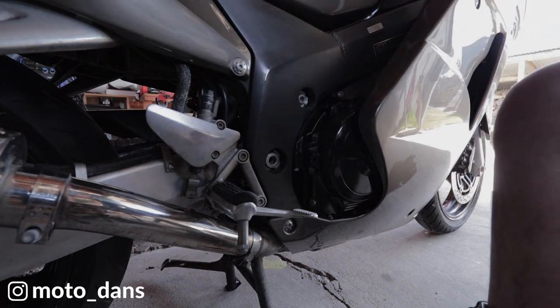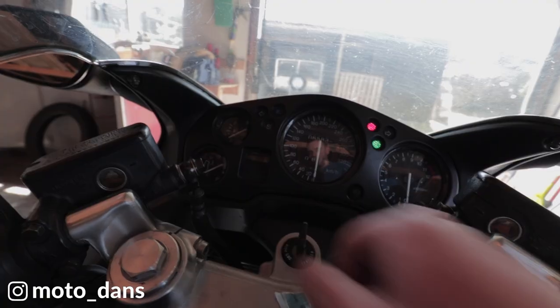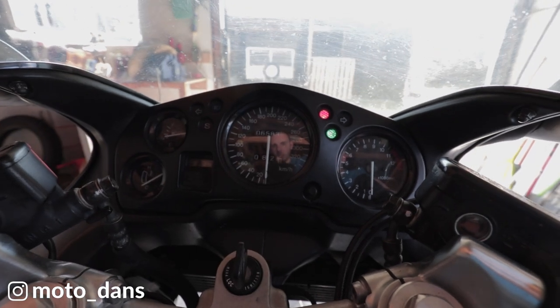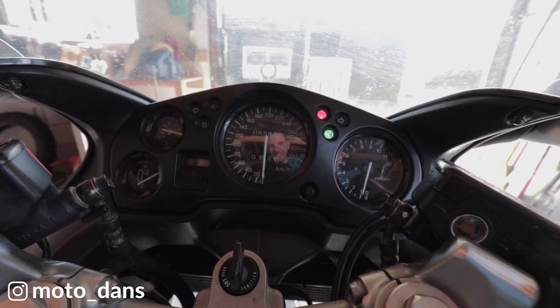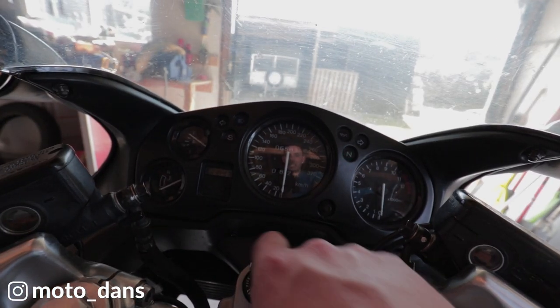It's about 3.5 litres, so I think we'll start it up at that and then check the dipstick. So I want to start up, just basically run it for maybe 10-15 seconds, probably not even that long, just enough to let the oil light go out, oil pressure build up. That'll do. And now we need to check the oil level.